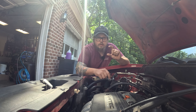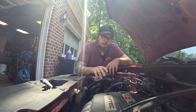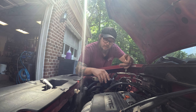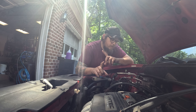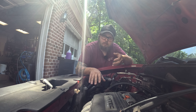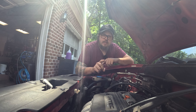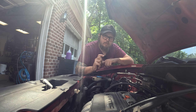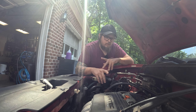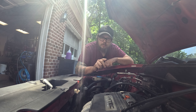The plug on top of the VTEC solenoid gets corroded out from water and stuff dropping in, and they're really close to the header so it gets hot and brittle over time. I've already replaced that on this one. Mine is profusely leaking oil all around the lower side of the VTEC solenoid. My theory is that the VTEC solenoid gasket is busted. This solenoid has been off here a lot, so kind of not surprising. I'm going to pull it out and check the gasket.